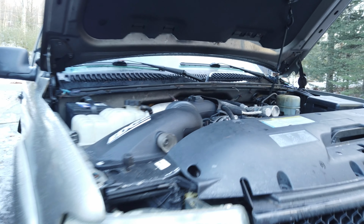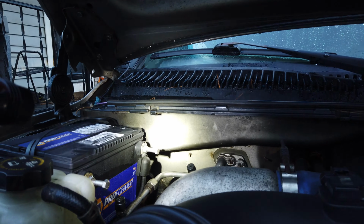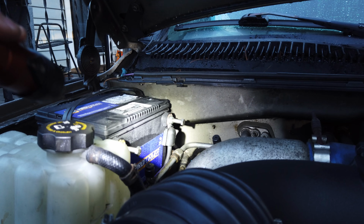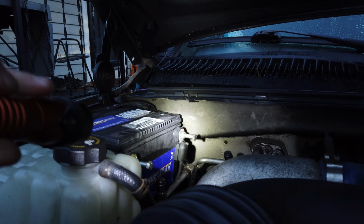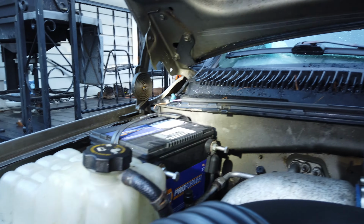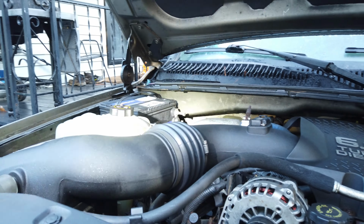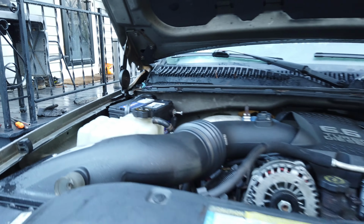Now, the absolute first thing we're going to do is we're going to disconnect both batteries. All those brand new shiny Napa batteries. And a little trick I will show you that I've done is that's a 3/8 bolt. Something simple, just cut this casing back. And if you know anything about side post terminals, you know as much as I do that they are terrible if you want to jump start a vehicle. So I replace them with a stainless bolt and a nut. It's pretty simple. And then that gives you something to jump off of and, you know, connect your accessories and whatnot. But first things first, before you do anything with electrical, disconnect the negative cable on that battery, on both batteries, that is. So that's what we're gonna do first.